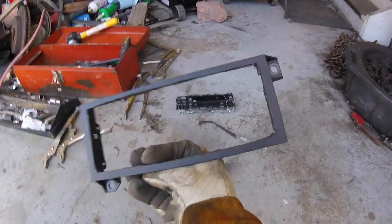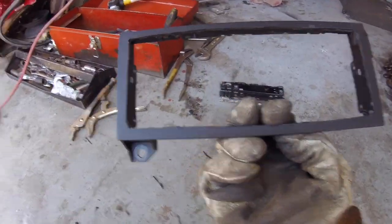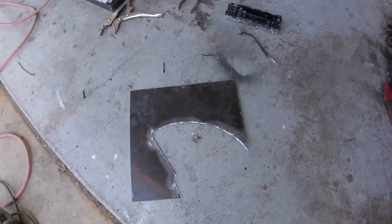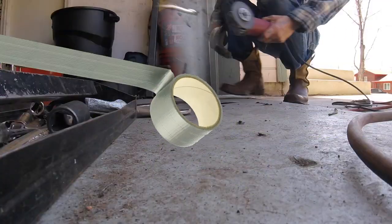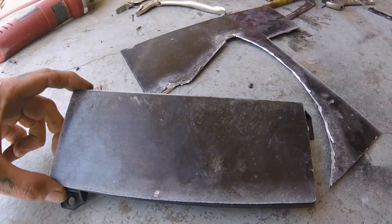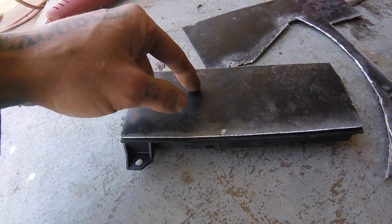With all that out of the way, we can trace this onto a piece of sheet metal, cut it out, make it smooth, paint it, and drill some holes - probably three on the bottom and three on the top - then rivet it to the frame. Found a piece of aluminum left over from my custom gauge panel in the Bel-Air, so I'll map that off with a marker, cut it out, polish it up, and put it right back on. Now I can start punching holes for the actual switches themselves - probably multiples over here, run and radio start over here.